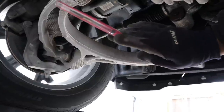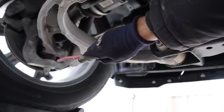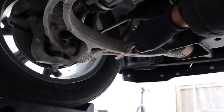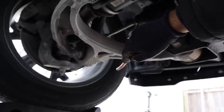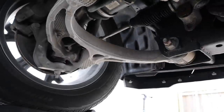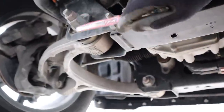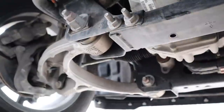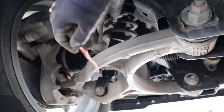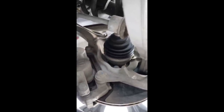Next up let's take a look at the suspension. Here you can see we just have one bushing at the front and one at the rear with this giant C-shaped arm, the strut hooked up at the middle, and a single ball joint out at the aluminum knuckle. Both the knuckle and this control arm are made of cast aluminum as opposed to steel, and there's only a single ball joint, whereas the Jeep Grand Cherokee I reviewed had a double ball joint with two separate control arms — so the setup is quite different, more like a Ram 1500. There are fasteners here that control the camber. One thing I don't like is that many newer vehicles use disposable fasteners whenever you work on the suspension — you have to replace them. We've also got the sway bar bolted up to the frame, going over to the sway bar link which attaches to the control arm. Inside here you can see we've got a bolt-on bearing, which means you don't need a press in order to change it out when it wears out.